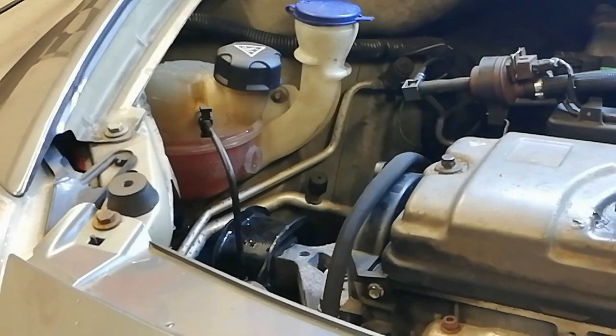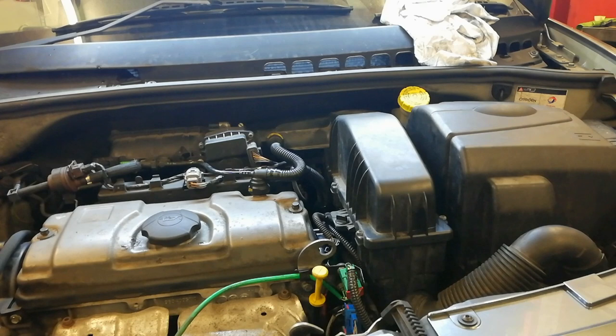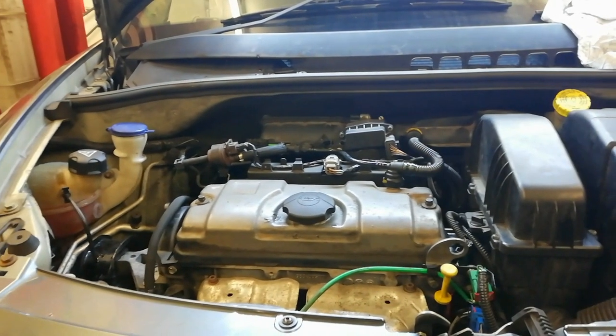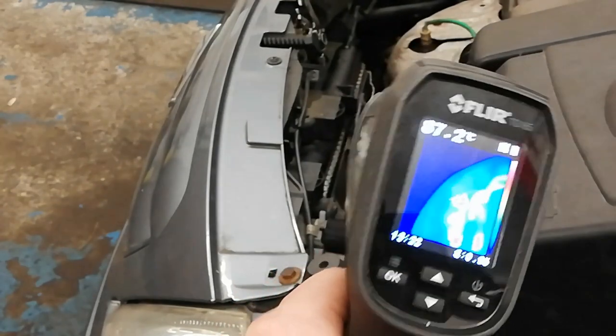I think that's it for this one. I did use those bleed screws but not heavily — it just filled up fine with a bit of patience. So there's a little bit on another method of how to fill a cooling system without coolant going all over the place. You could just top it up and put the cap back on and run it, but this does it all in one go — and I think that demonstration showed the advantage of that spill-free funnel.